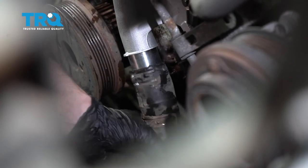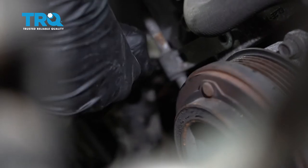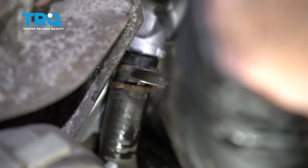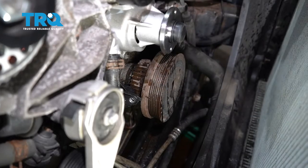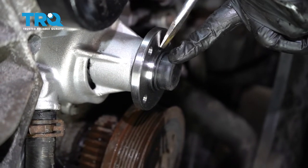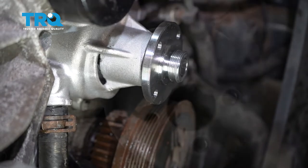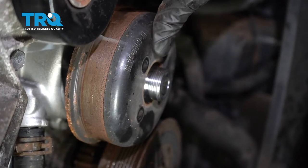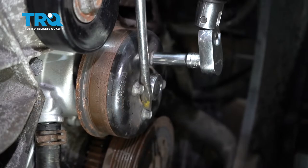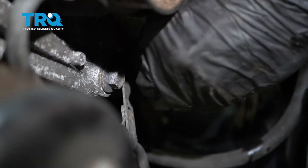Time for the lower hose. Let's grab this other hose and clean this down, getting off any of that coolant in the area. Now let's make our way to this area right here — pop this protective boot right off, set that aside. Now we can start putting our pulley on here, lining up all four of our bolt holes. Start in all four bolts, snug them up, and then torque these to 18 foot-pounds. Now let's get this bracket bolt in there and snug this right up.